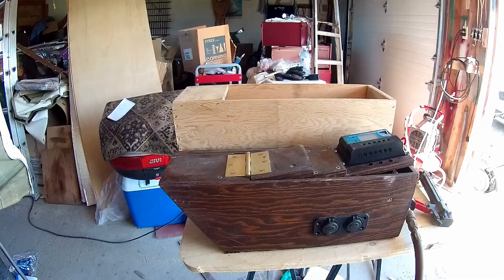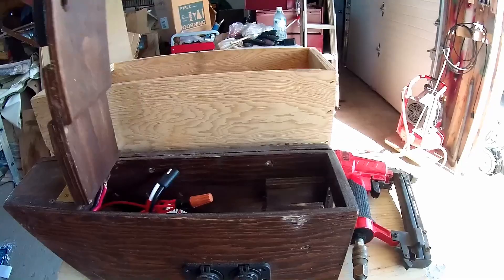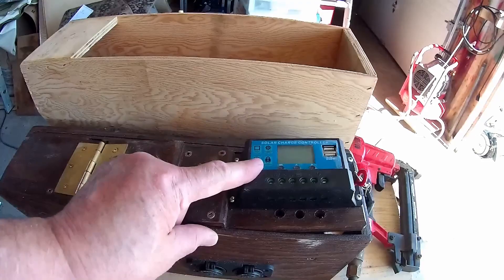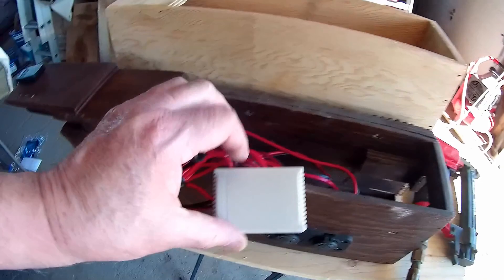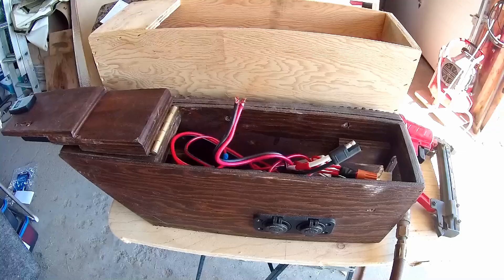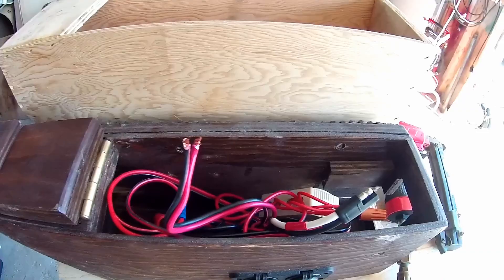You can see how much larger the new boxes are going to be. The batteries are a little bit bigger, taller, but I also wanted more room for the electronics. I am putting a different controller on — this one I fried, which is really too bad, but we can deal without that. Inside there is my little four-channel remote control. What I need to do with that is make sure I've got an on-off switch, because it's a radio, so it's always got power to it. That's one of the things that was draining my battery and I hadn't realized it.